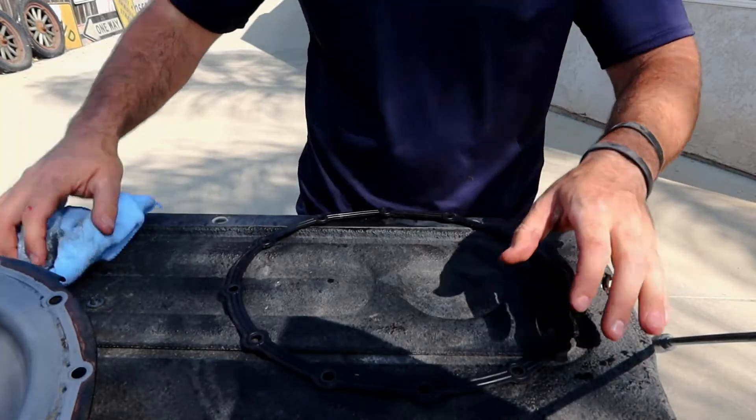Alright guys, that is it — a job well done. After doing the front differential — I believe I told you it's a 2.3 quart capacity — for me we used almost two and three quarters, a little bit more. So three quarts for sure should do each differential, especially if you do them at the same time. That way any extra can go into the back one, which I'm gonna do next, and the process is the same. I like to wipe everything down extremely clean so it's easier to look for leaks down the road. We will link everything below so it's easy for you to find, and like always if you purchase from us it does help us out and we appreciate that. We hope you enjoyed this video and found some knowledge — if you did, or if you have any questions, put them in the comments, give us a thumbs up, don't forget to subscribe, and we will catch you on the next one. Bye.